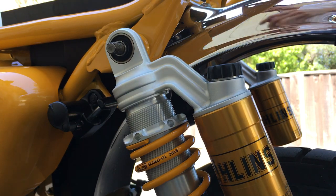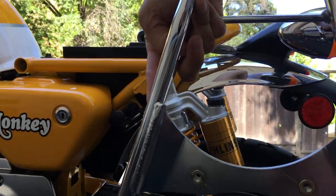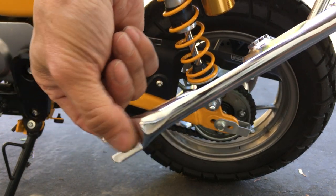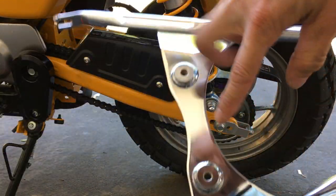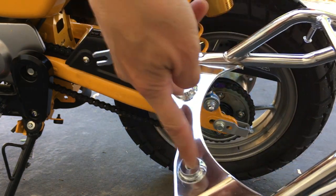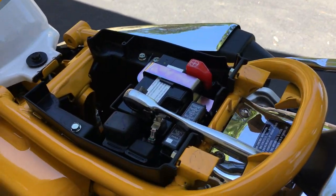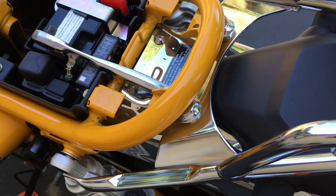Let's get the rack. Here's the rack. The rack goes in like this - this is the top of the rack right here. This is where it slides into where the shock mount is. The rack has two spots right here - basically it has threads on them and it's been welded. These are the nuts, so those two bolts that come with it will screw down into this. When it mounts, the rack actually mounts from the bottom of the frame.